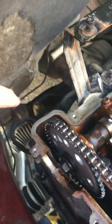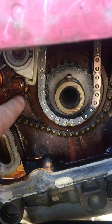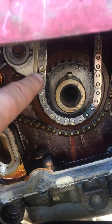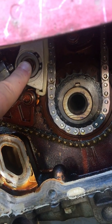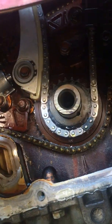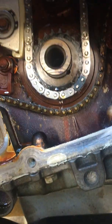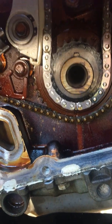What happened was I went to go replace that thing back there, and when I took the old one out, apparently some chain slack fell down to the crank sprocket — which I'll show you, right here. This is the pivoting tensioner guide shoe, and when I pulled it out, this thing tilted backward and allowed some chain slack to come down here, and it threw off this mark right here. So I turned it on, it skipped a link, and it had a code.